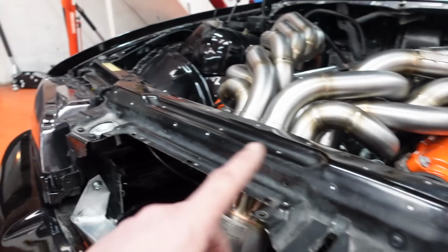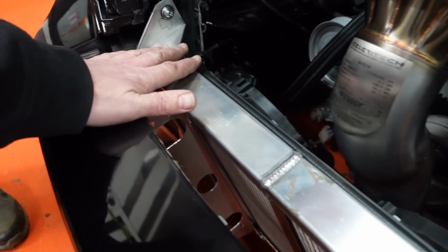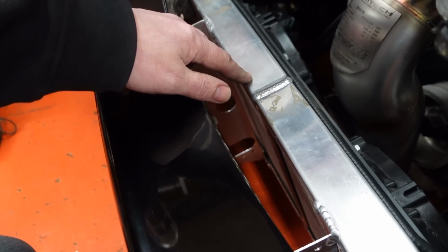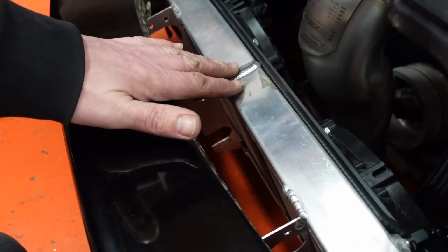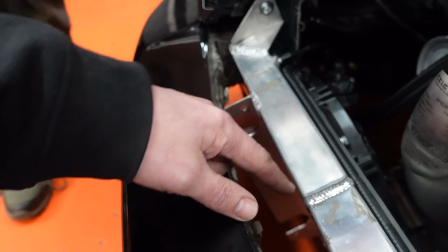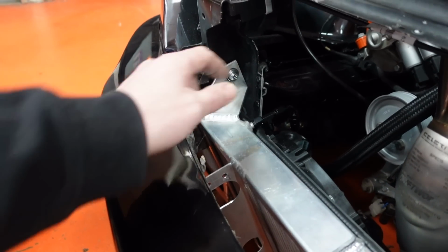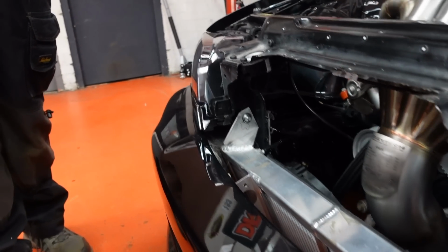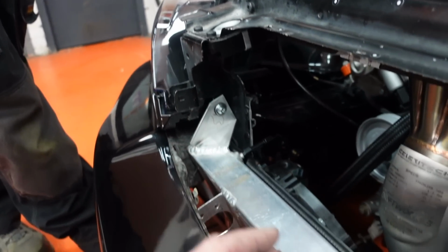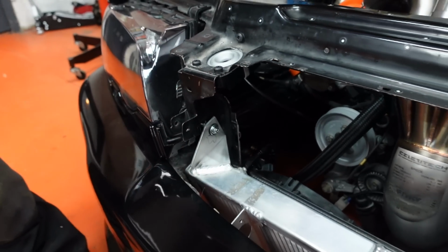Yeah. So this is made out of aluminium. We are going to probably look at creating a plate that sits here and works as a guide for the radiator anyway. You basically want to keep as much of the pressure of air going through that radiator, so it's a good thing to fill that in anyway. But we're thinking a plate here, which means these lovely brackets that Craig's already made need to go, and it's probably going to mount into this zone here, and then it's probably going to have an upright here to support this and give a bit of triangulation.